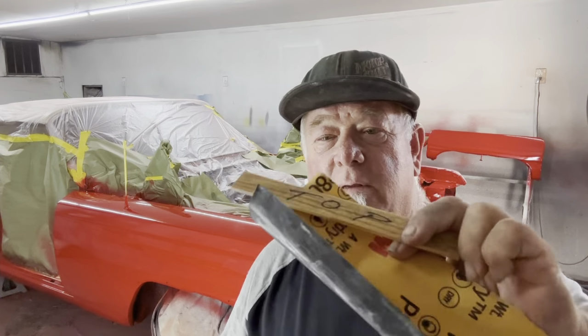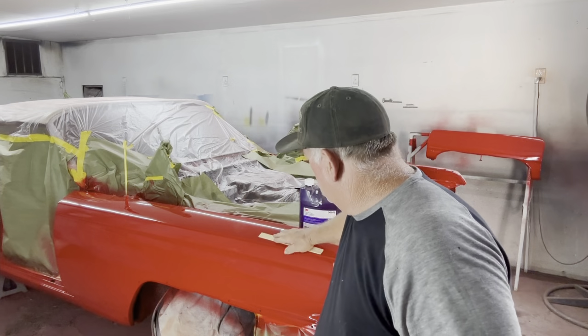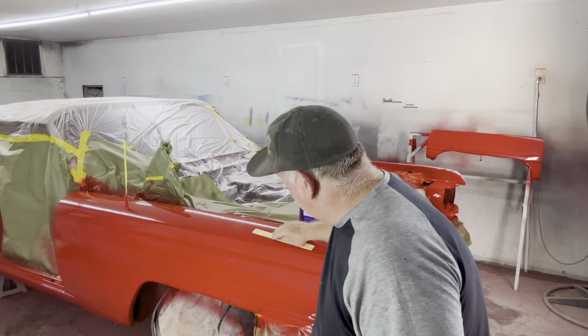So what I do is I use a paint stick. It's just like any old paint stick. This is what it started out looking like. We cut them down to fit the paper, and then we grind the edges off, make them nice and clean. You want to get the straightest one you can, to make the paint straight, right? If you don't have these from the paint store, you can get really nice ones from Lowe's, Home Depot, Ace, whatever, that are actually better than these. These are a little small, but they still work fine. It takes a little hand coordination to use these because they're kind of thin and small. So you want to have your hand spread out so that you're hitting as much of the stick as you can while it's on the car. Like this, okay? You want to be able to get the car straight.